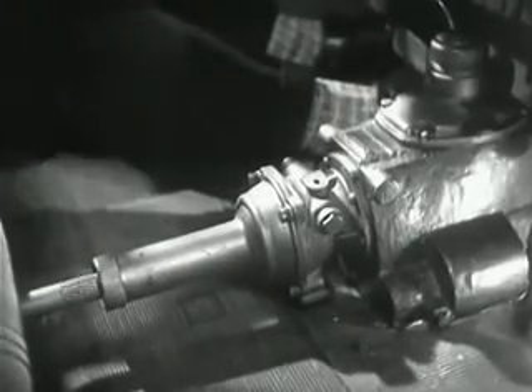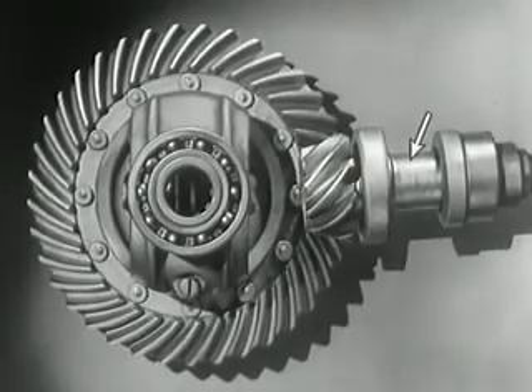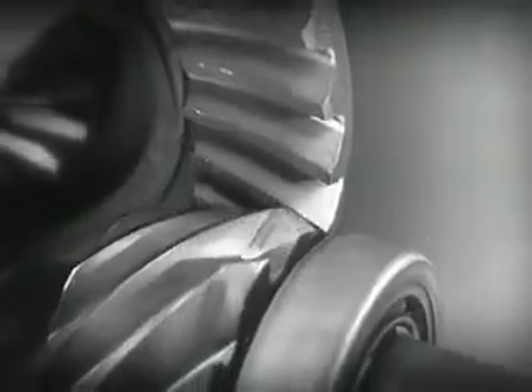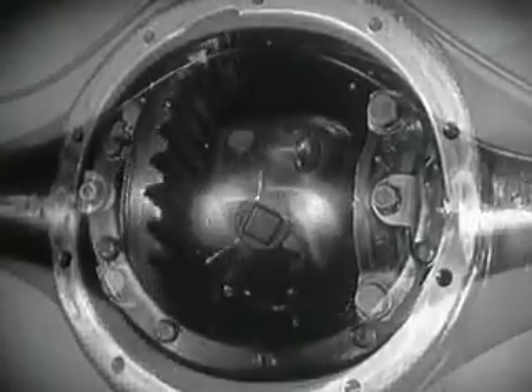This would have disadvantages. A shaft in the middle of the floor of an automobile would be inconvenient for passengers and would be awkward for carrying luggage. Today, engineers have found a way to make the car roomier and closer to the road without a clumsy shaft above the floor. The drive shaft from the engine to the differential is lowered out of the way, and connected to the rear axle at the bottom. The new low center drive makes the rear axle quieter, stronger, and more durable because it gives better, smoother contact between the gears.